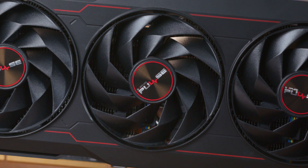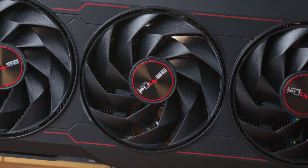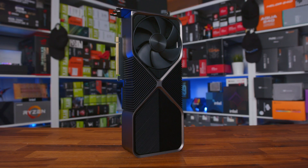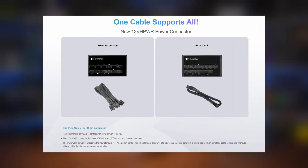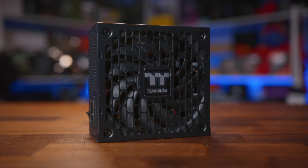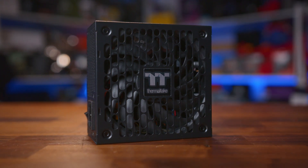While AMD have managed, at least in the 7900 series, to maintain using eight-pin power connectors, Nvidia chopped things up on the 40 series for this new single power cable. If you don't have a PSU that has the connector, adapter cables were bundled in with the relevant GPUs to at least get you up and running. But as we all know, that comes with its own set of problems since launch. The connector actually allows different power limits to be implemented while using the same connector, so in the future we may see 150-watt, 300-watt, and 450-watt cables that make direct connection to the PSU itself.